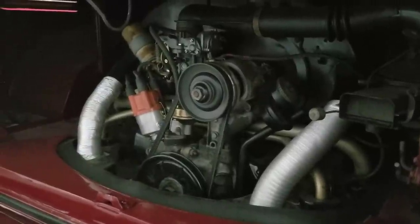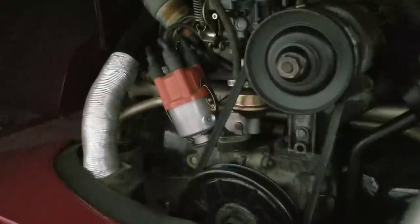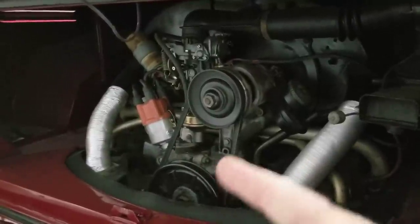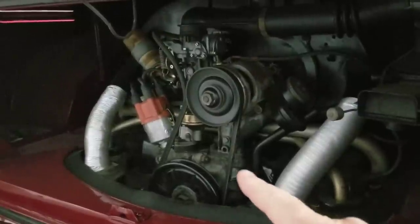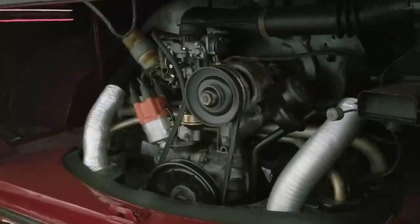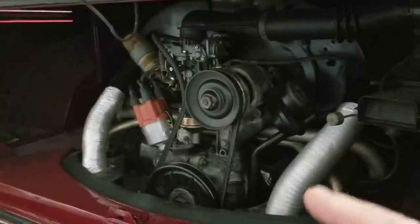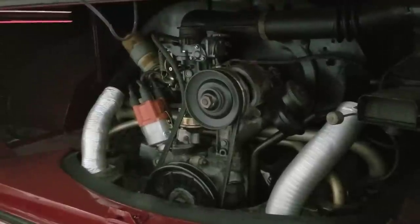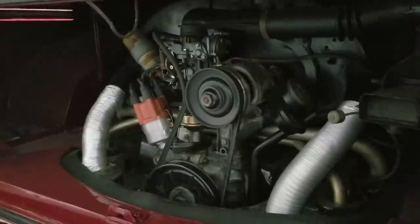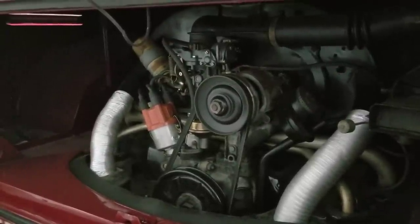On the outside of the engine, I really like the electronic ignition. The new MP ones haven't been too bad — they had a bad run for a while but this one here has been fine. The original engine had a retarded third cylinder on the distributor lobes, which makes the old VW always idle a little rough. They did that so the number three cylinder wouldn't work as hard as the other cylinders — retarding it makes that cylinder run cooler and do less work than the other three.